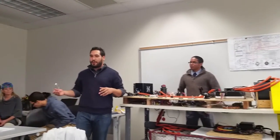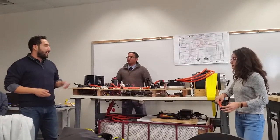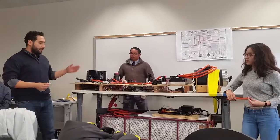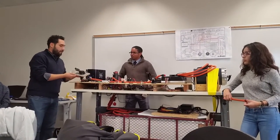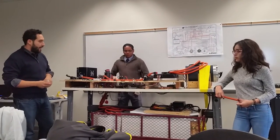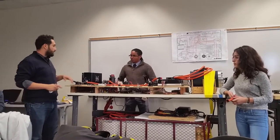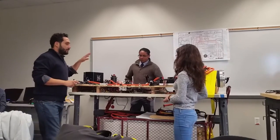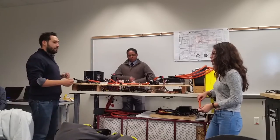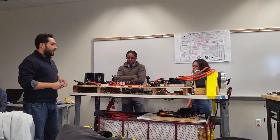You saw that big picture where we have all the parts laid out on the floor, a whole bunch of wire, and nothing but that schematic to work with. We basically had to figure it out piece by piece, system by system. Down here you have the 33 cells which power up this motor, and it gets recharged with this wall inlet — which is what you'd plug into your house. Once your batteries are powered up, all this high voltage runs through that high voltage wire, into the main gate where the voltage goes into the system. It travels from there to the computer, which controls everything through the low voltage wires. Once we have the low voltage system running, you can hear our contactors open the flow of electricity through the whole system, and essentially we're live.